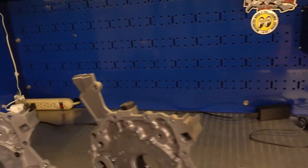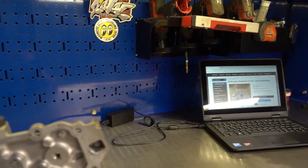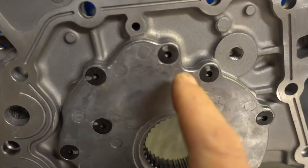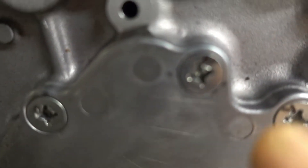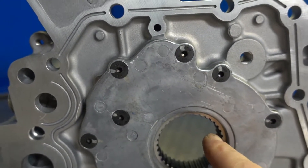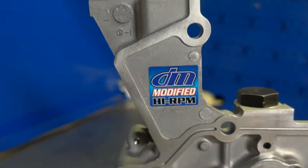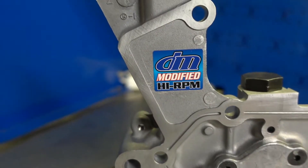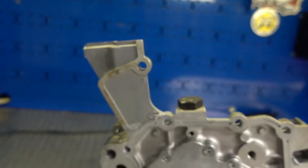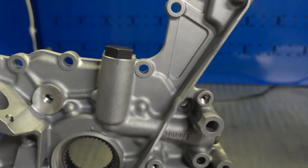With the regular modified pump, I'll give you a quick description instead of reading the whole paragraph. For one, they take this thing apart and replace the bolts — they put Allen bolts in here instead of the factory Phillips heads. What that allows them to do is actually torque these things properly and equally all around, because behind this cover is a gear that spins and it's very critical that it has a flat surface. That's one of the things you notice right away on the outside. Then they put a sticker here which basically says that the pump has been modified.